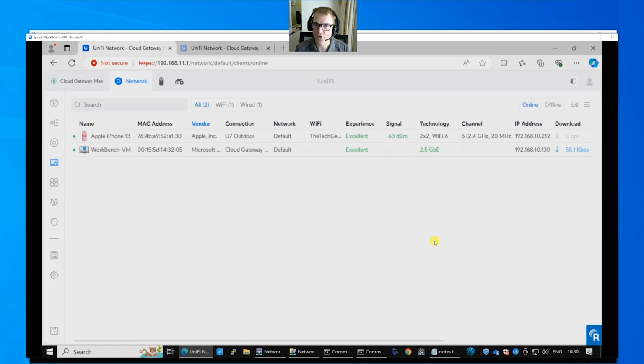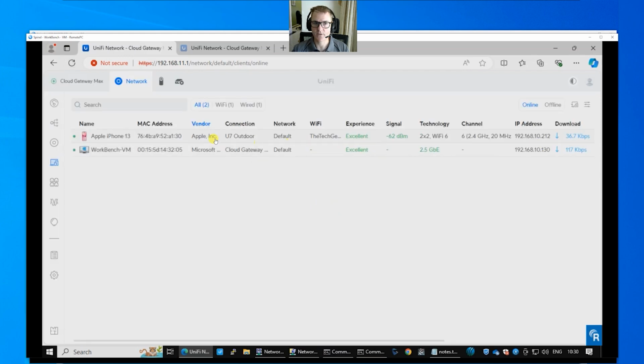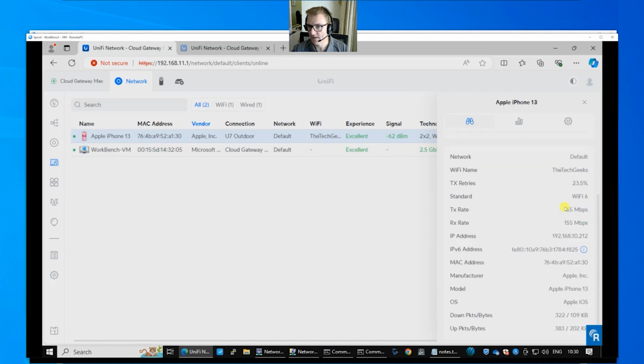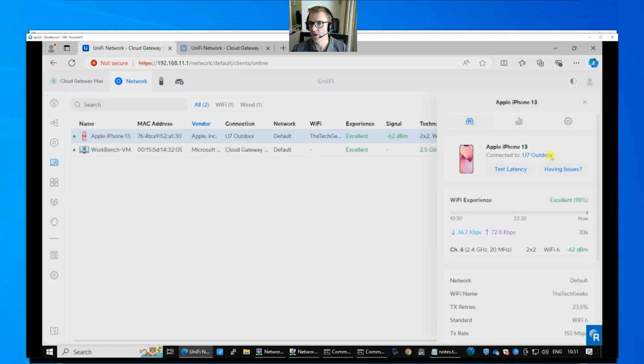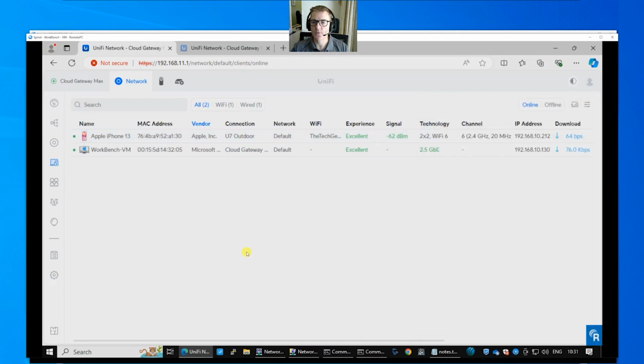This is cached in the device and is actually restricted. I can see it already showing on my mobile phone. And so later on, when we come back, you'll see that this has picked up a different physical IP address, and I'm in the 192.168 range. So there's nothing I can show you at the moment. We can go on and show you a little bit more of the advanced configuration of what we can now do. So we've now separated out these two networks.